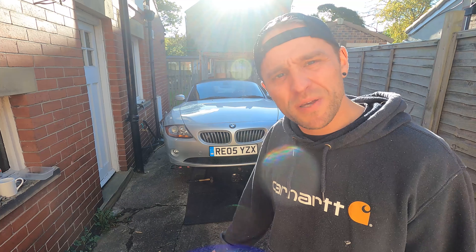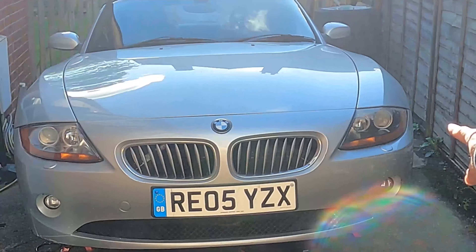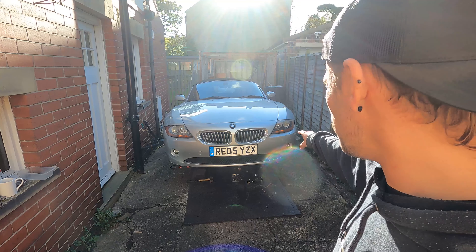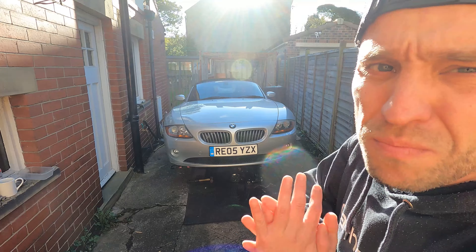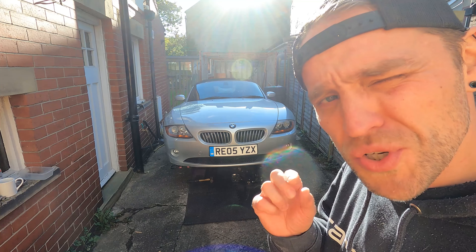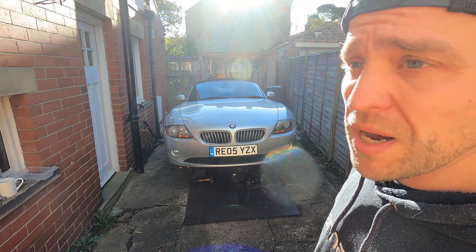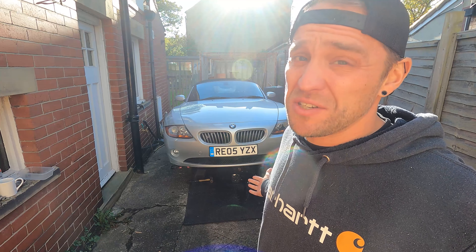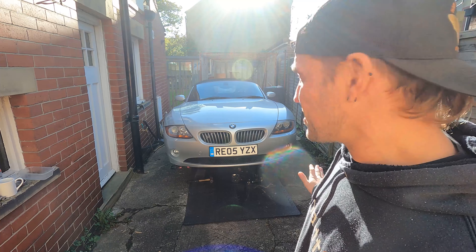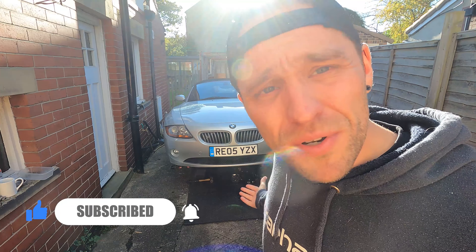Hello and welcome back to the channel where I've been restoring this 2005 BMW Z4 back to its former glory. In the last episode I restored the headlights — there's still some condensation on one, and it's the wrong colour, so I'll swap it for the correct silver one. More importantly, while the car was up in the air I spotted a pretty bad oil leak that looks like it's coming from the oil pan gasket. I'm going to take the oil pan off, replace the gasket, and while I'm in there replace the notorious oil pump nut that has a habit of unwinding itself on these cars. To do that I've got to drop the subframe, and since pretty much all the suspension components are attached to the subframe — and they're all knackered — this is my opportunity to completely strip and refresh all of it. It's going to be a big job; we've finally got a good day's weather, so hit like, hit subscribe, and let's do this.